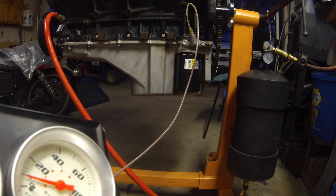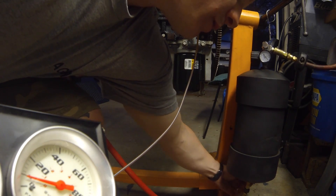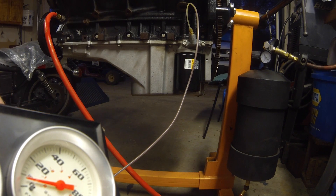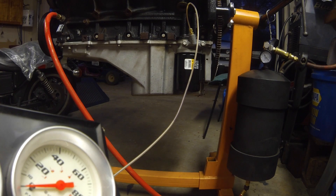The oiling system has been primed — right now we're just pushing the rest of the oil from the container into the motor. I'm going to go ahead and cut it off early rather than risk pushing air into the engine, because I know the whole system is full now. I'll push the rest of the oil into the valve cover until I get some type of sight glass to let me know when I'm low on oil in the container. Alright guys, that's it — hope you enjoyed the show. That is the external oil primer for an LS motor. Stand by for pictures of the build.